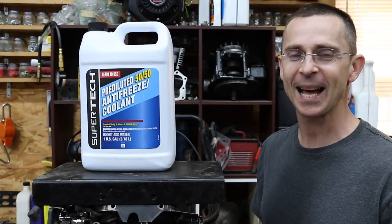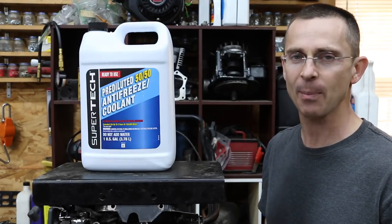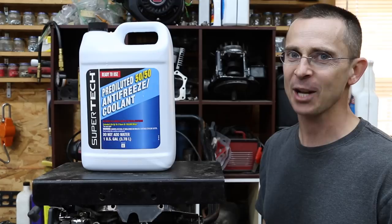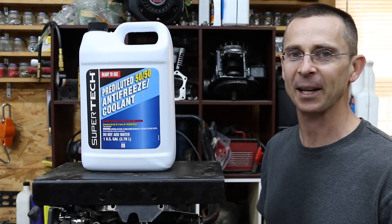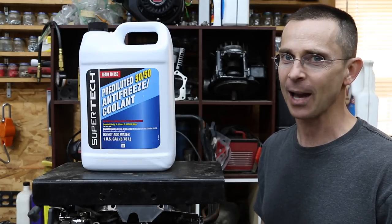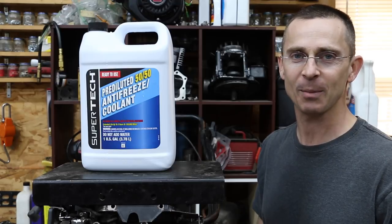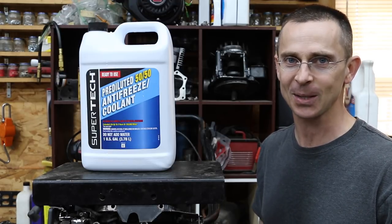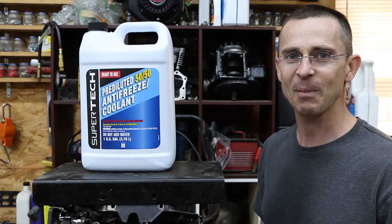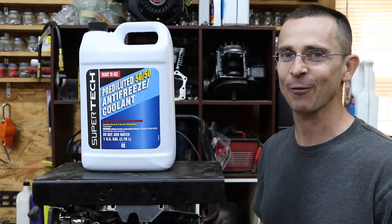I'm really surprised at how well that worked — I did not expect the drip to work so much better than the spray mist. However, I think the spray mist really helped soak into the carbon and loosen it up, so when the drip was used it really took care of the buildup. Please do not try this on your automobile engine or anything with a catalytic converter or sensors, because antifreeze is definitely not meant to be used as a carbon cleaner. A lot of mechanics wrote in and recommended this, so thank you very much — I read your recommendations and I do videos on them, so please keep those coming. Are there other non-traditional products you've used to clean carbon buildup inside an engine? Please let me know in the comments. Thanks so much for watching — please like, share, and subscribe, and I look forward to seeing you next time.